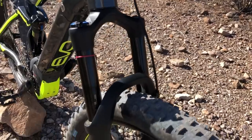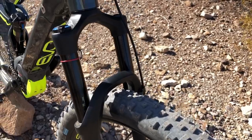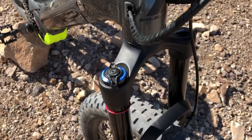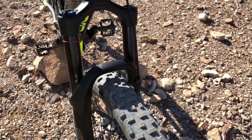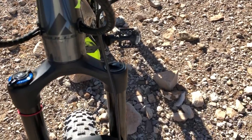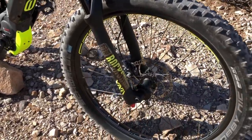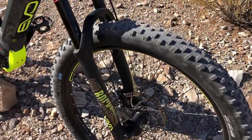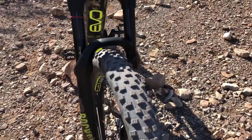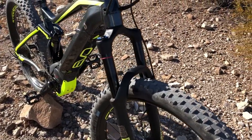Here's a closer look at the RockShox Yari suspension fork. Just like the rear, it has 150 millimeters or 5.9 inches of travel. There's a lockout lever at the top for smoother roads, and on the other side you adjust the air spring to your riding weight and style. There are also damping adjustments to make the fork perform the way you want. It's been sized to accommodate plus-size, nearly three-inch wide tires — overall just a very smooth fork.